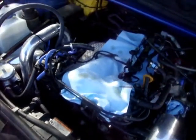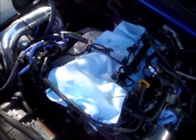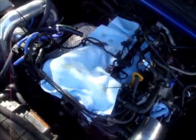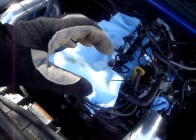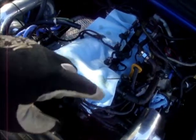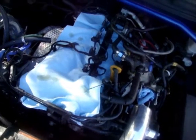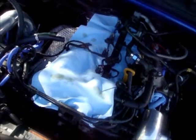The one thing I'm a little disgruntled about is that switching to an aluminum valve cover on this engine is probably not a good idea unless they take into consideration those oil galleries. The other thing I noticed is that the ports on the oil galleries themselves are actually different sized from one side to the other. I don't know if that's done on purpose because there are actually trace marks on the smaller one for the larger one. But that's another interesting design detail from Hyundai. So there you go — I hope you guys have all learned something today and we can stop some of the arguing and discussions on the forums in regards to this, because here's proof.